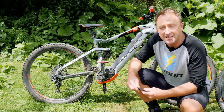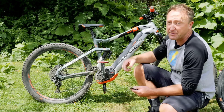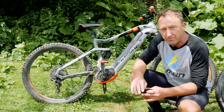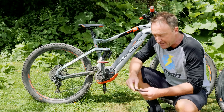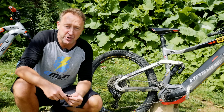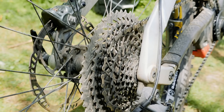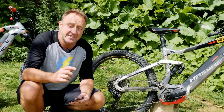First up, let's have a look at two typical scenarios of front sprocket and cassette setup on different e-bikes. This is a Haibike Enduro 8 — it's got a 16-tooth front sprocket on it and an 11-42 cassette on the rear. Bear in mind that some bikes actually come with an anti-suck device on the front sprocket, which limits the size of chain ring you can fit to the front. This bike is a Haibike Enduro 10 and it's got quite a different setup in terms of gearing. It too has a 16-tooth front sprocket, but on the rear is an 11-48 cassette, which means it can get up a lot steeper hills than the previous Haibike 8.